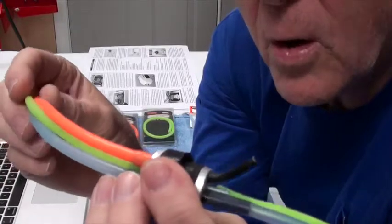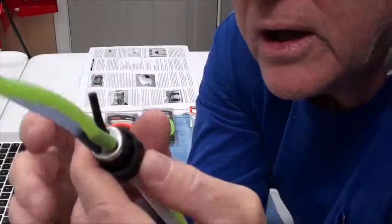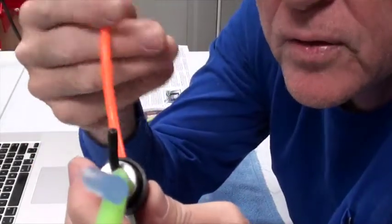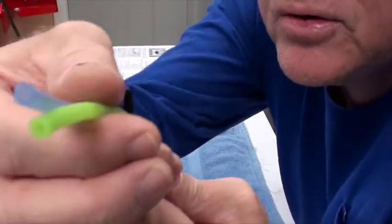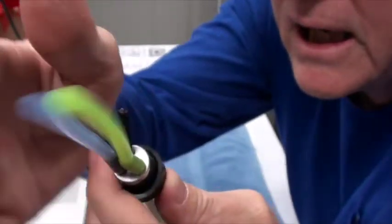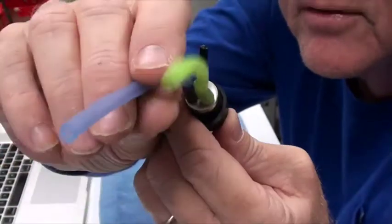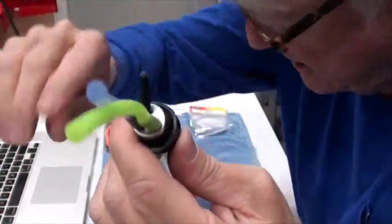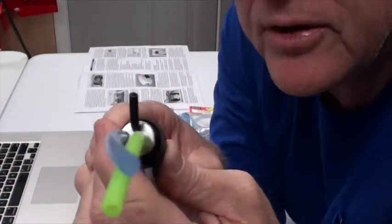So that's what the orange, green, and blue are for. The green and blue are inside the tank; the orange is for the vent. Now, the green and blue lines will both require a clunk. The reason for the clunk is that it needs to stay at the bottom of the tank — something needs to weigh it down, and that's what the clunk is for.